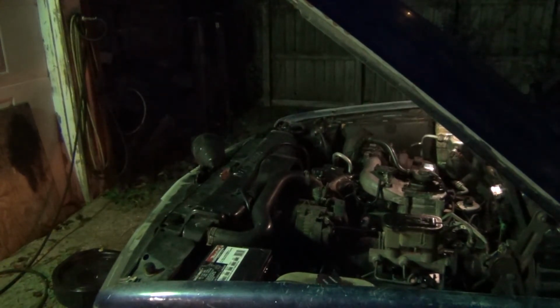Anyway, at the beginning on this truck, there was actually a wire going to the glow plugs on the right side that was pinched between the engine and the transmission. So I know either the engine or the transmission's been out. It took all kinds of work, replacing fusible links and stuff, to get all 8 glow plugs working, but I did do that. I replaced most all the sensors on the engine because they were all broken. The EGR is bypassed. It causes a lot of soot.